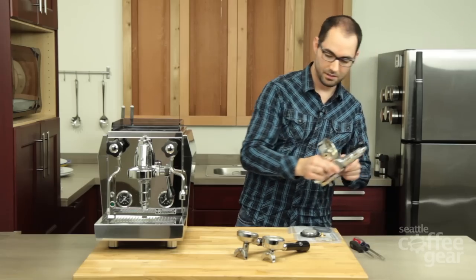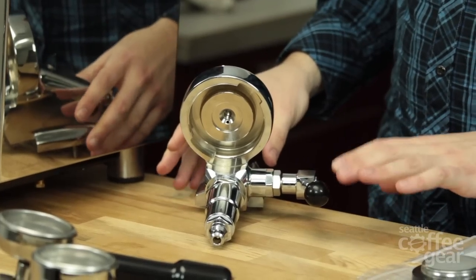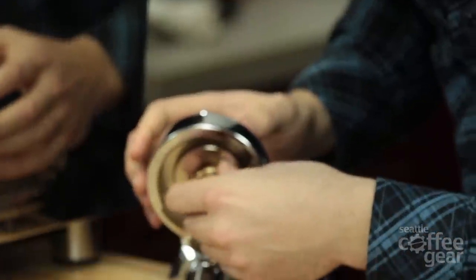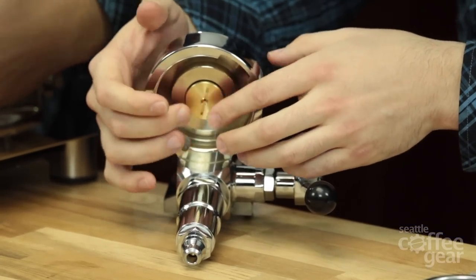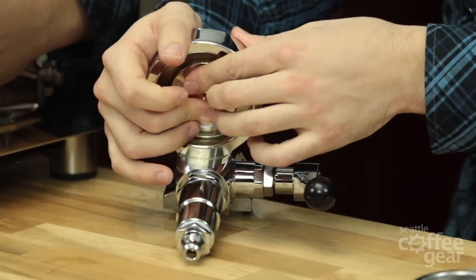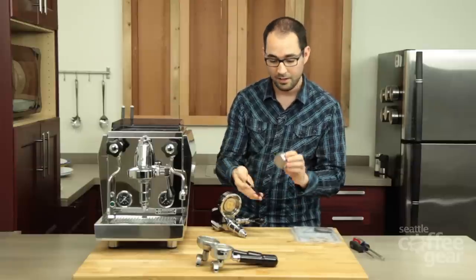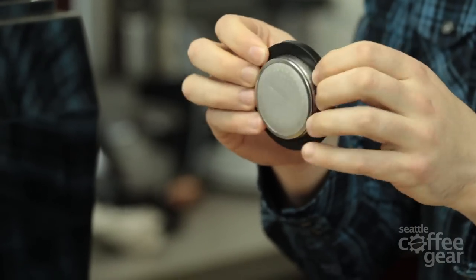For the purpose of filming and to give you a clearer view of exactly what's going on, we've actually removed an entire E61 brew head here. After everything is cleaned, we're going to put the diffuser back first. Get it as clean as you can — that's important. Thread it back on and only finger-tighten it. You don't want to tighten this too much; it's made out of brass, which is very soft. If you eventually have to take it off using a lot of force, there's a good chance you could strip that flathead screwdriver slot. Now the gasket goes right around the screen — there's a lip at the top of the screen for the gasket to sit on, and that's exactly where you want it.